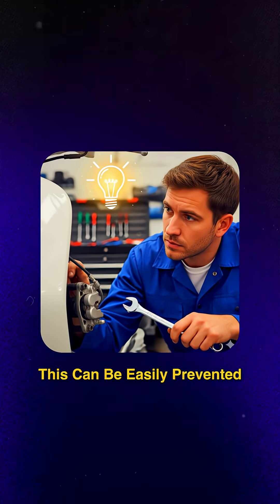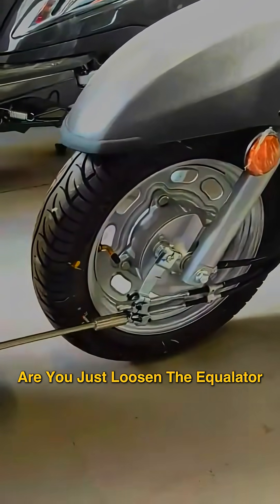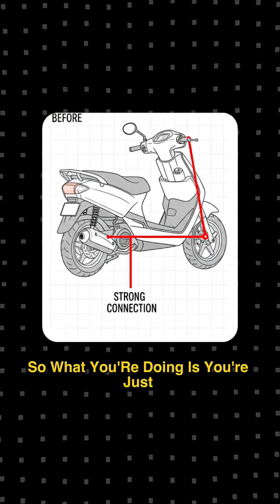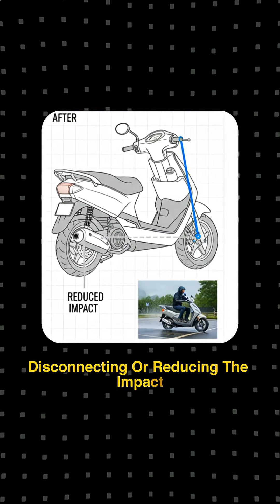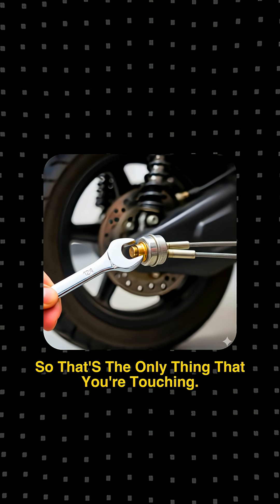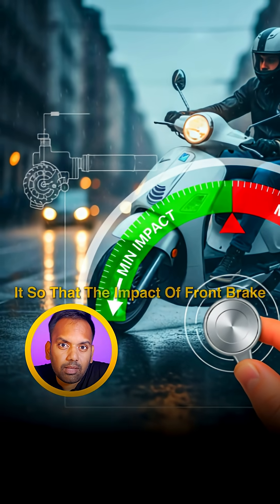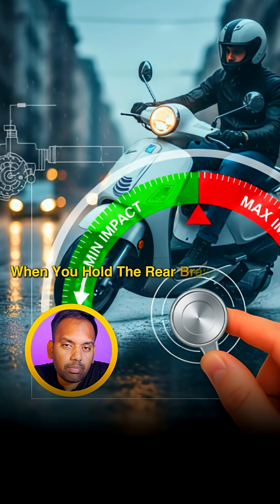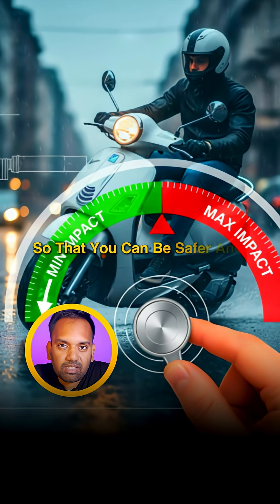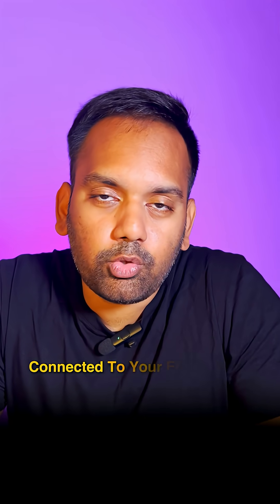So how do you prevent this? It can be easily prevented using a 12mm spanner. In most cases, you just loosen the equalizer which connects the front brake cable. What you're doing is disconnecting or reducing the impact on the front brake when you hold the rear brake. You can tweak it so that the impact of the front brake when you hold the rear brake is minimized to the very minimal level required, so that you can be safer and prevent unwanted skids.